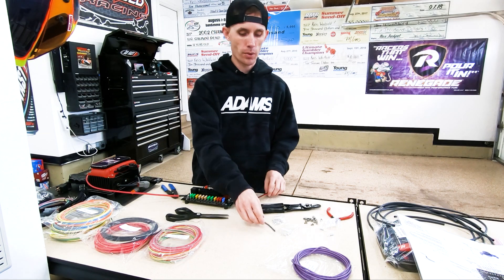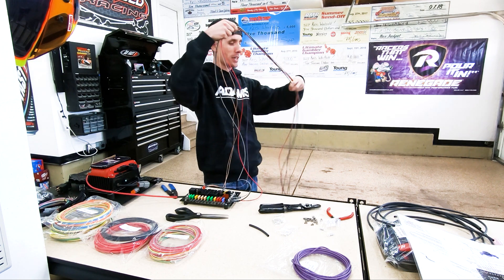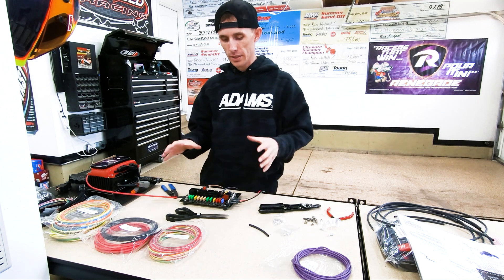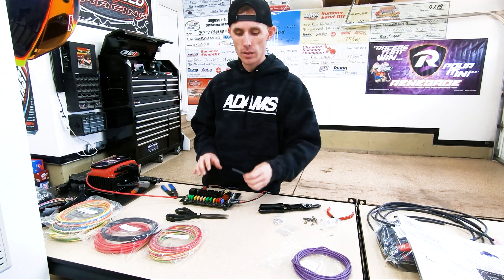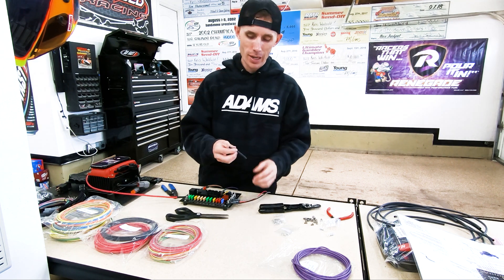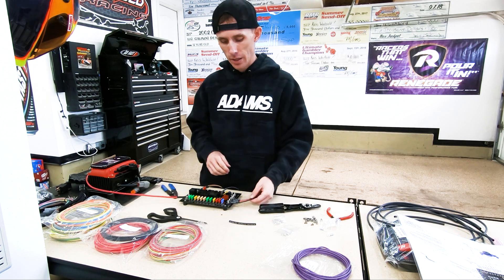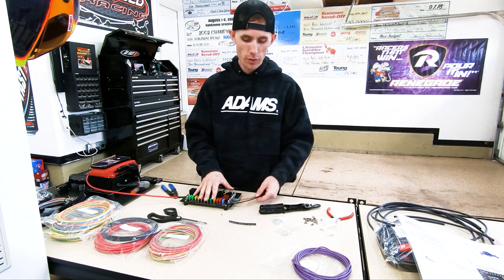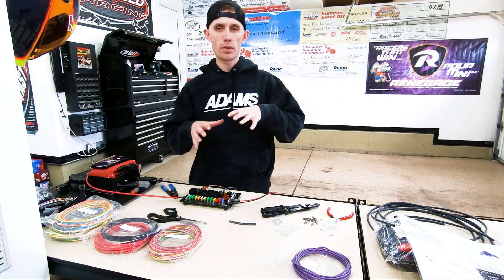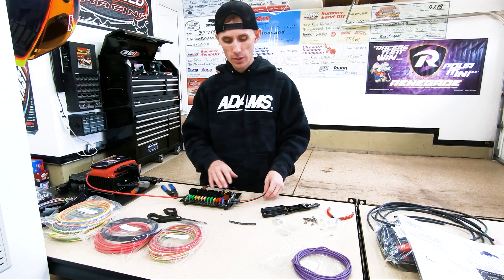One of the things you'll notice once you start throwing wires onto this board is that things can turn into a mess really quickly. I've already got kind of a knot going on, and this is where you start to lose hope that you're going to have a clean job. But what I'm really trying to focus on is everything right here close to the board. This kit comes with labeled heat shrink tubes, which is really nice. As I cut them, I'm paying attention to even the most minute details — making a straight cut on the shrink tube, making sure all the wire labels read the same way. Small details like that really add up along the entire process into making this a really nice finished product.